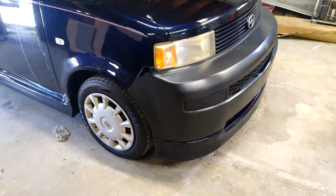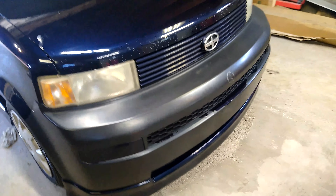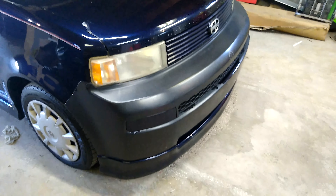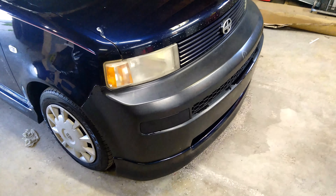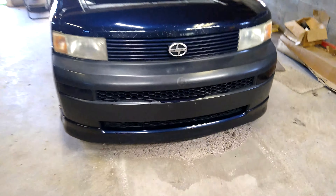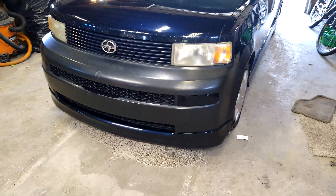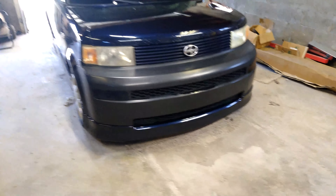The first thing we're going to do is flake off the rest of the paint that's still flaking in spots. Then we're going to tape up everything we don't want overspray on and just leave this bumper exposed. We'll tape off the bottom part that's already painted. Then we've got to get some residue off — someone had a peace sticker on there. We're going to wipe it all down with some wax and grease remover and then go straight on with that rattle can. Let's get started taping this thing up.